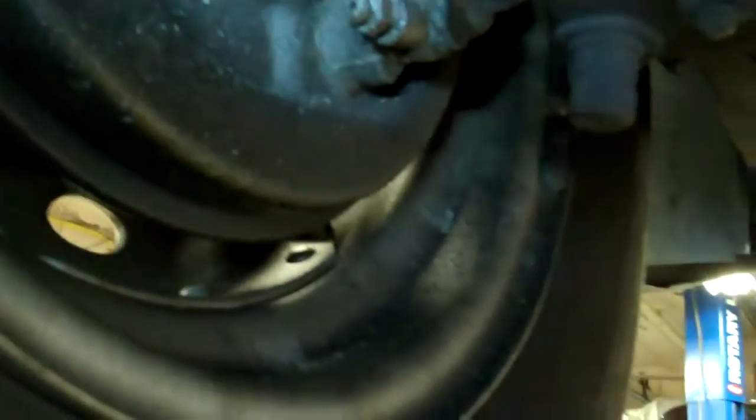At the same time we're going to have to replace the brake shoes — these are all contaminated with grease, probably giving you some type of soft pedal. You can see how shiny they are from all the fluid contamination. Looking at the other side, we haven't pulled the tire off the drum yet, but you can see the same grease leaking out from the axle. We're going to have the same issue when we disassemble this side, with contamination of the brake shoes and changing both seals.